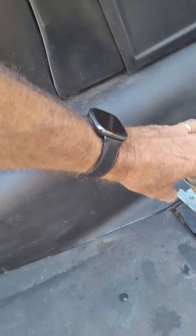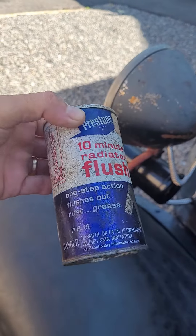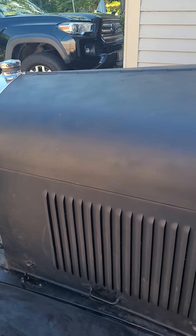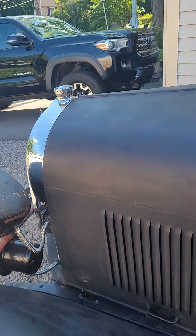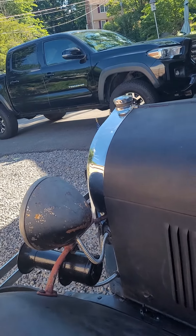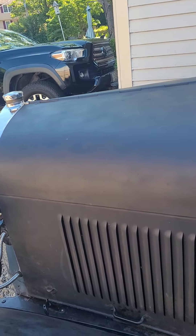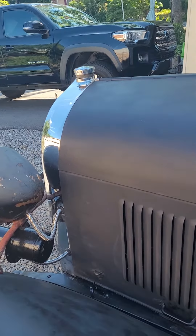What I'm gonna do — I'd like to get it down at least 10 degrees. I got some pre-EPA Prestone flush that I've had kicking around in my shop for about 30 years. I'm gonna run it this week with that in there — they say run 50 to 100 miles with it, drain it, flush it, maybe run some water with automatic dishwasher soap in it, then just run straight distilled water with a water wetter and anti-rust, to see if I can get that 10 degrees cooler for longer trips and the bigger hills.